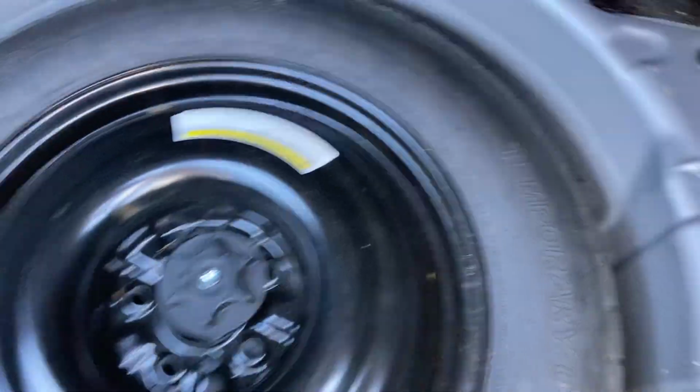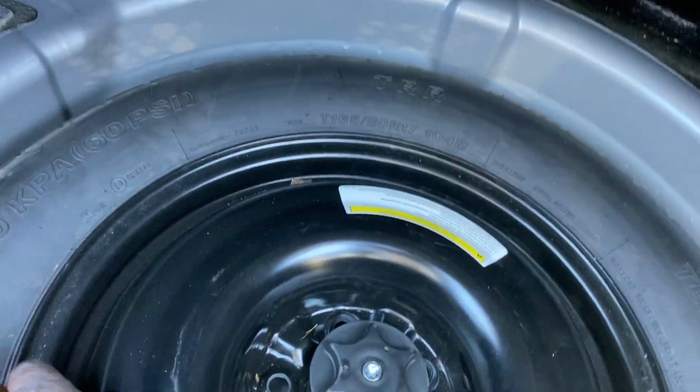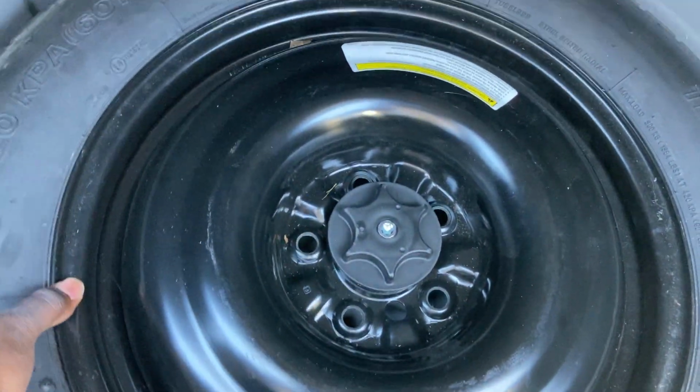Pull this up, see what the rear looks like. Looking for wetness as well. Tells you if you've got issues with your sunroof drains. Nice and dry. Okay, trunk is good. Spare wheel exists. Looks like it's been used, which is okay. That's what they do. Okay. No serious rust inside here. No signs of repair. That's fine.